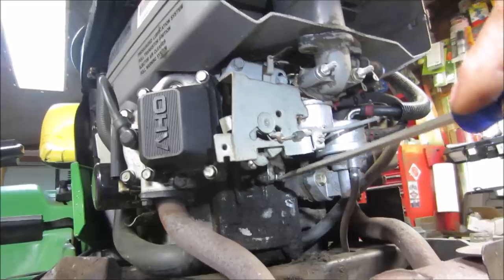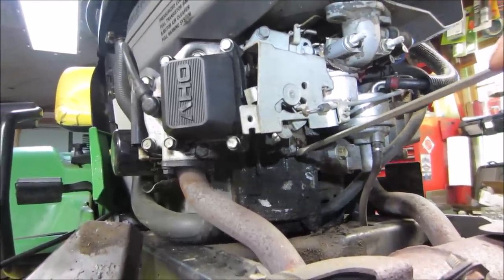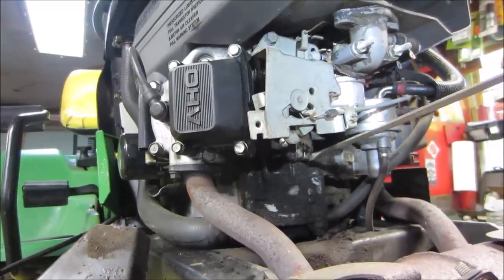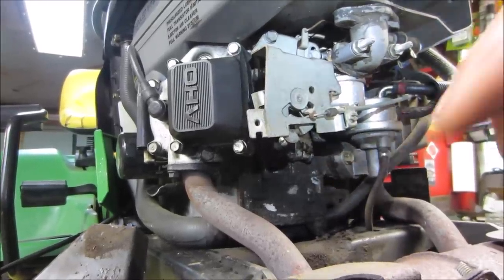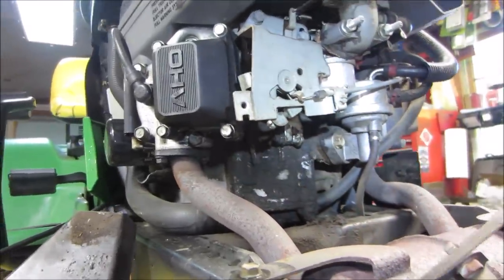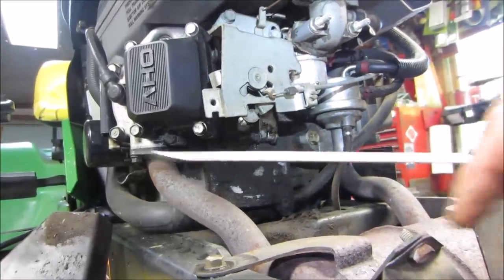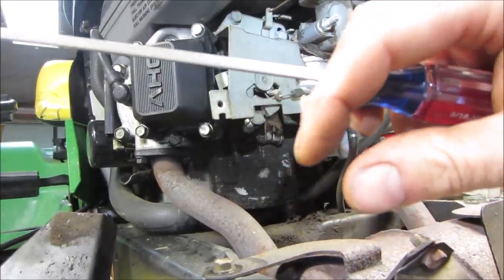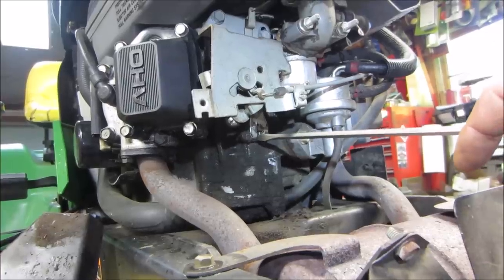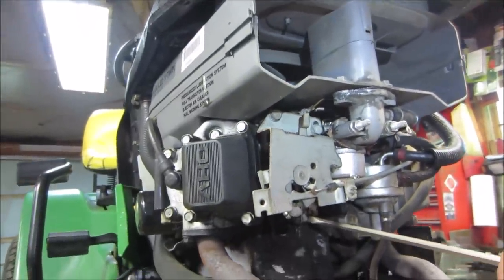And what it has inside the engine, there's a couple of different setups, but inside the engine there's essentially a set of fly weights that run off of either the cam or the crank, and as they spin faster, they'll have the lever go back the opposite direction. They want to try to maintain that width of wherever they are. So as they slow down, it turns the arm one direction. As it speeds up, it turns the arm the other direction. You can see the assembly moving over there as they turn it.